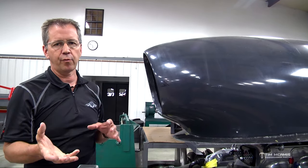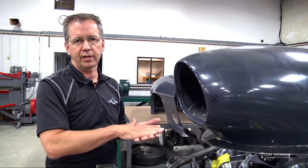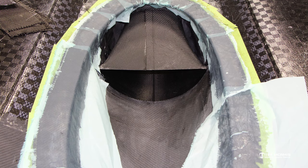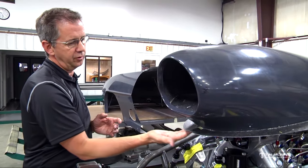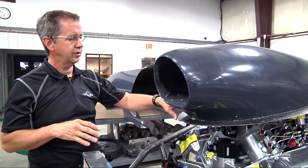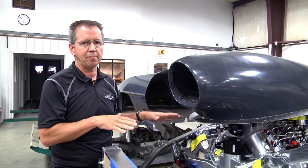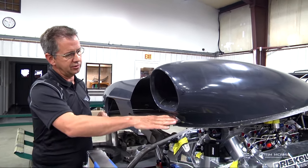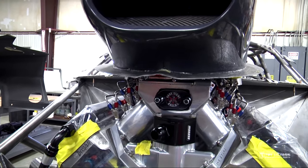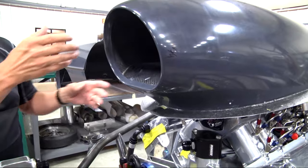We can then flip it upside down on a stand and fabricate the flange right onto the bottom of the scoop. When we flip it over we're looking at the bottom side of the hood, and we use masking tape to protect the bottom of the hood so the fiberglass won't stick to it. The bottom side of the hood gets a layer of tape around it, then we rough up the inside of the scoop and use carbon and resin to lay this lip up right on top of the bottom of the hood, rolling it onto the inside of the scoop. Once that cures, you've got a nice lip that follows exactly the bottom of the hood — that's the mounting flange the hood will set on when you slide it back on. Once the bodywork is done, it will all look like the stock piece.